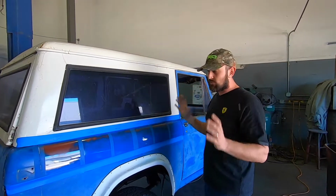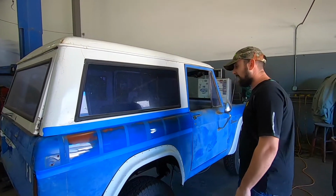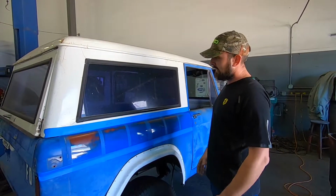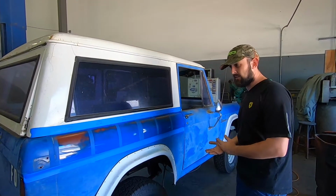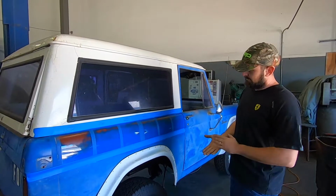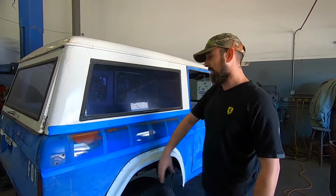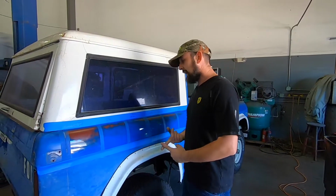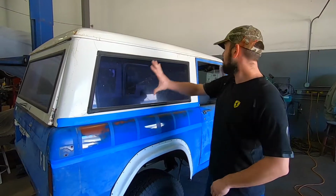If I could only choose one, I'm afraid of using the rotary with wool on most cars because it's simply not necessary to bite it that hard, unless it's a really fresh, brand new paint job that I'm having to block down with 2000 grit and get out a 2000 or 3000 grit wet sand job. The 3401 is my baby. It's my versatile buffer. I use that sucker on everything from my wife's new Camry and my new Tacoma to this. I mean, what am I going to use on the rest of this?